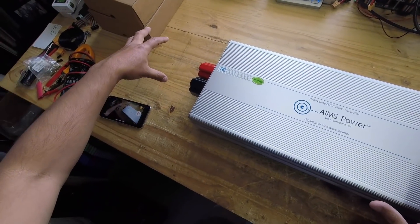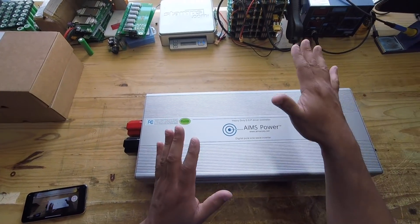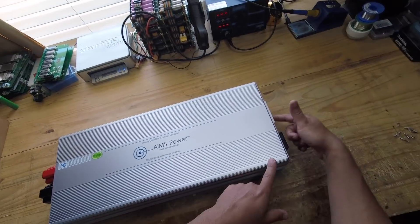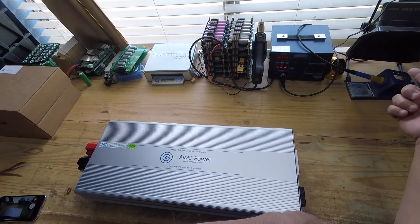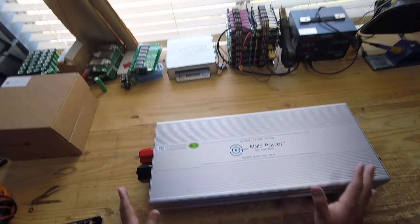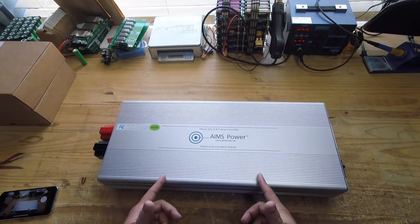The easiest approach is to use low-voltage batteries — 24 or 48 volts — and then an off-the-shelf inverter like this one to convert it to 120 volts AC. From AC it goes into the car, which uses its onboard charger to convert back to DC at 400 volts. It's not the most efficient way of doing it, but it is the easiest because you can use off-the-shelf components.